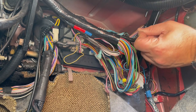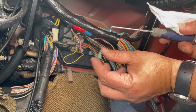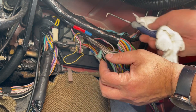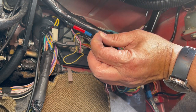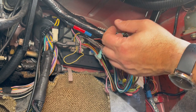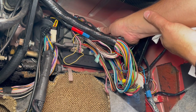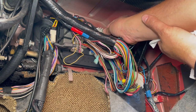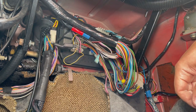So you got to make sure that if you feel too much tension or too much interference getting to plug in, you got to go in with like a pick or something. Just make sure that the little female receptors on the plug are not pinched closed or forced bent out of the way. So just make sure that you get a good positive engagement and it doesn't feel too forced. It should be a nice positive engagement, like a nice snap or click once it gets in there.